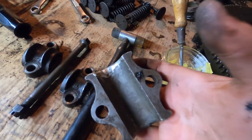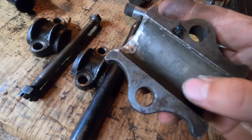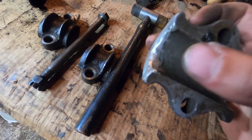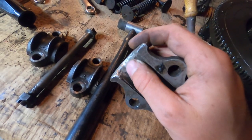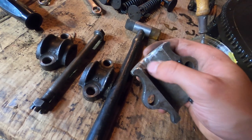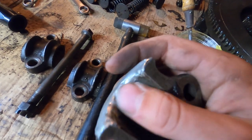This time it worked out a little bit better — I got a better surface on each side for the added material. I did mess up slightly in a similar way, not as bad as the first time, but I was able to add material and scrape it a little bit and I think I can fix it. Because it's not the original bearing that came with this engine it is not going to be fitted to the crank, so we're going to have to do that. The crank surface has little ridges and divots that won't match this bearing from a different engine.